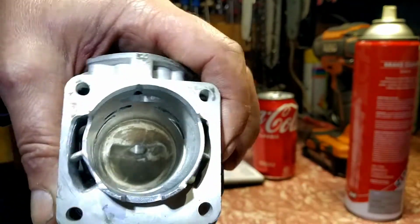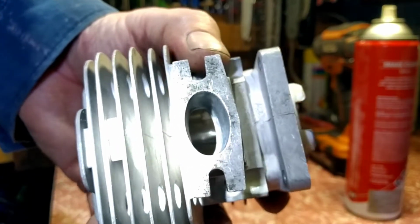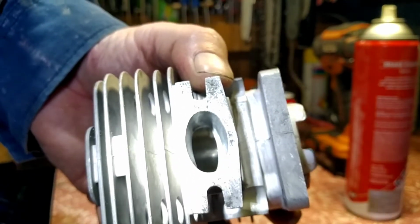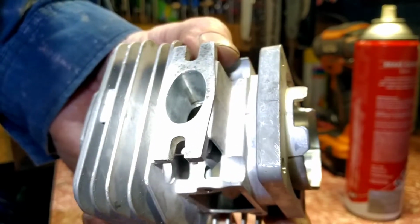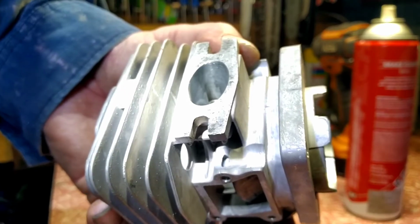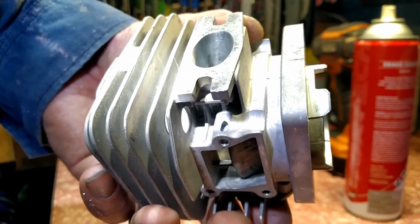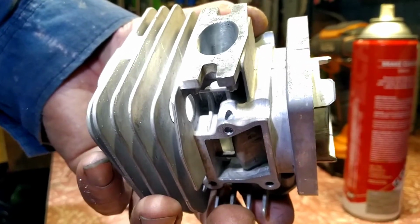Now the exhaust, I went towards the roof of the exhaust just a bit. If you look in here, hopefully you can see it, the exhaust has got a lip right around. I cut that lip out the top and went down just a bit more. It's not much, but that gave me the blowdown I needed. So 23 degrees blowdown is plenty for this thing, and that's what you want.